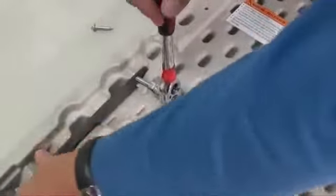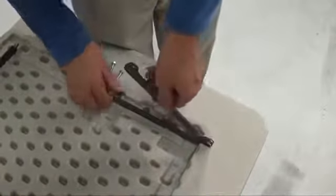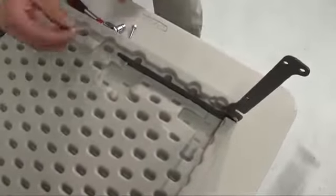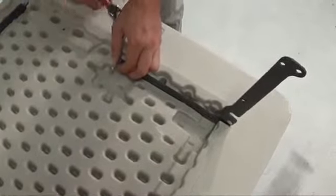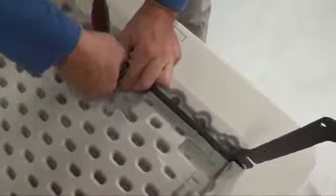Note: the panel is plastic — only tighten the screws until flush with the hinge; do not over tighten. Slide a second hinge onto the right side of the lid and press down so it's flush with the lid. Note: this hinge does not use the ball studs. Use two screws to secure it in place, and again, do not over tighten.